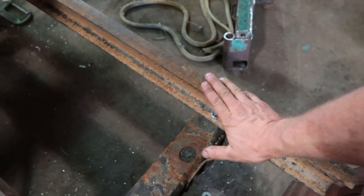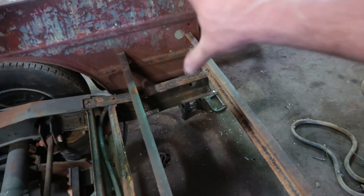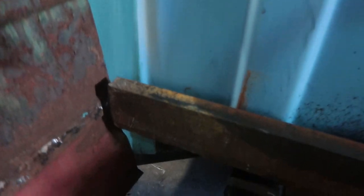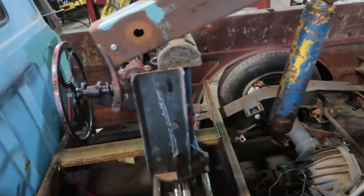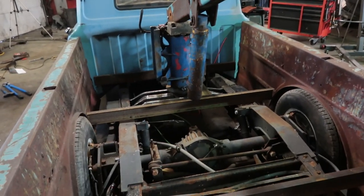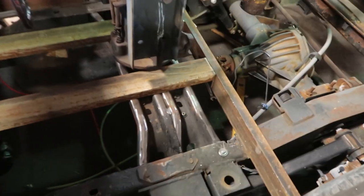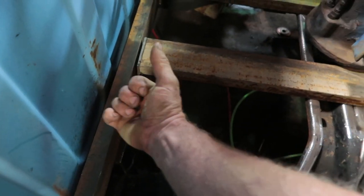I centered my C-channel, which just happened to be the right height to go over top of our arches, then just drilled a hole and put a half-inch bolt on both sides. Centered it left to right and that'll position our box sides properly. Did another one on the front here, and because this is up higher since I dropped the frame, we had to weld a little angle bracket up there to hold it to the right length. Originally I was going to put the C-channel this way, but when I put the boom in place with the extension all the way in, that flexes quite a bit. So instead I cut these pieces and they are going to go in between the bedside, bolted in like that. I made a plate and I'll drill the holes and mark them front and back.